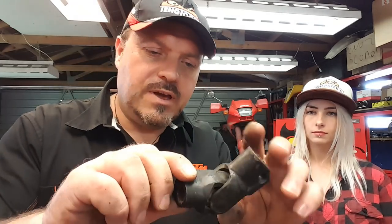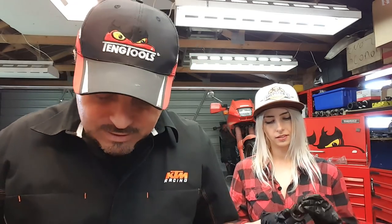The UJ that we found, just check that, Sam, any good? Feels pretty smooth in both directions. So you just do it both ways. Feels quite smooth. Excellent. So the UJ was a pass. That's good, but you must check those.